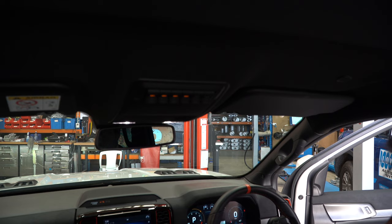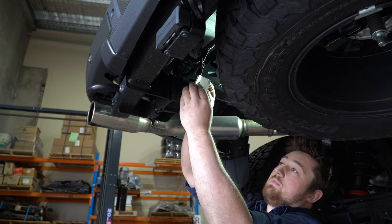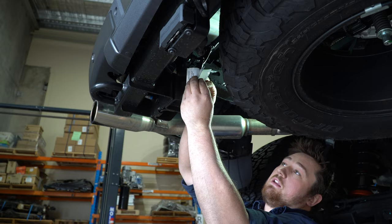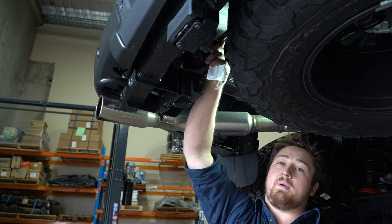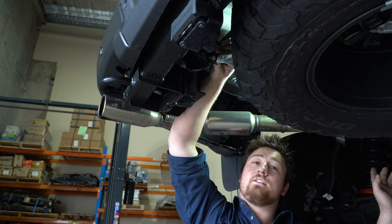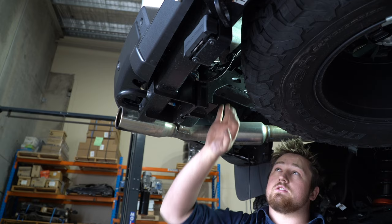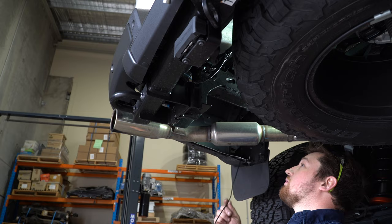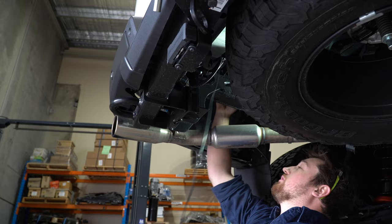Wiring in these auxiliary lights for the tailgate — hidden neatly up here on the chassis there is this factory harness. There are four wires inside of it and they're all labelled: compressor, camp light chassis, camp light ground, and the ground for the compressor. From factory, they've already installed the whole entire harness through this vehicle and we literally just need to plug in to these. Once we're plugged in here and put the power and earth on, that will go straight inside onto those existing auxiliary switches. Those six switches inside the car are pre-wired through to here, which makes it very easy to pick up powers and earths for all these additional camp lights. You can also use those switches — because they're not marked — for any accessory you need or want, as it's all dependent on your needs and requirements.